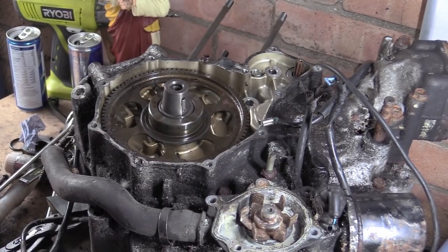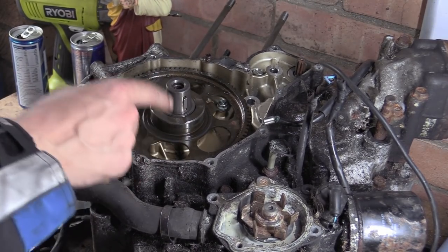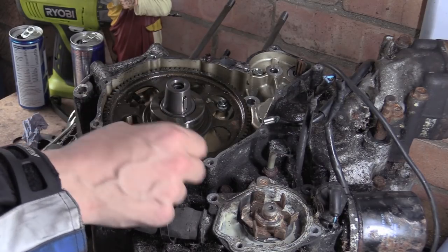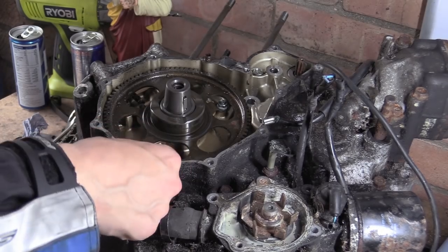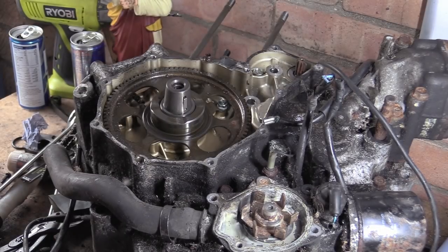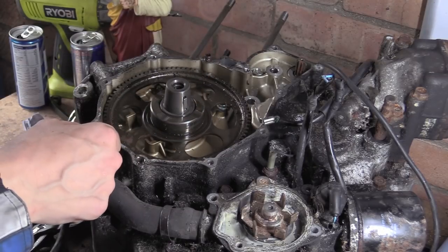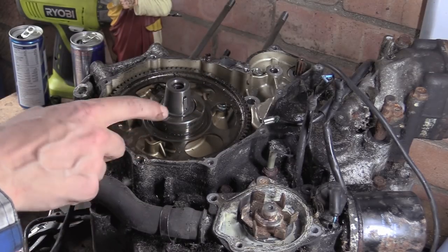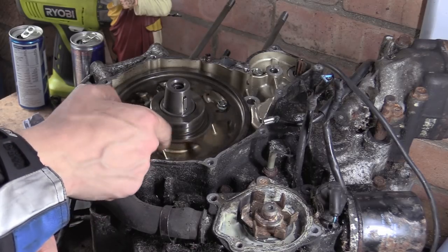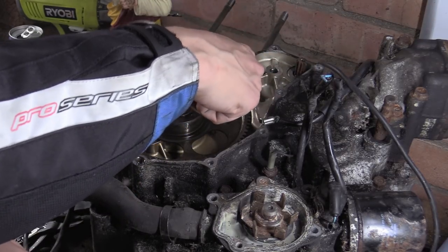Right then. So yeah, this is the big gear. And this is an excellent example. I'll actually refer back to this when we start talking about rotational inertia. Oh, it's like dog hair. Or some woman's hair. So this is the massive speed reduction but torque increase gear for the starter motor. So you've got starter motor, freewheeling pinion gear, a little pinion gear there.